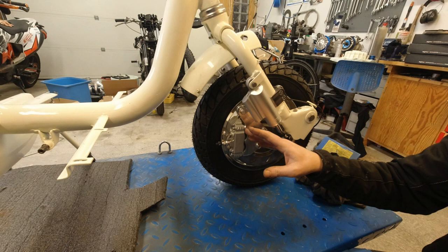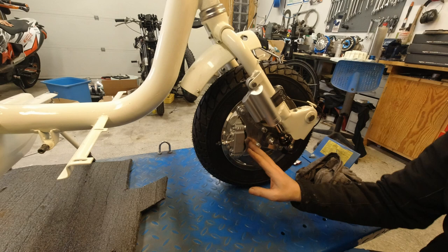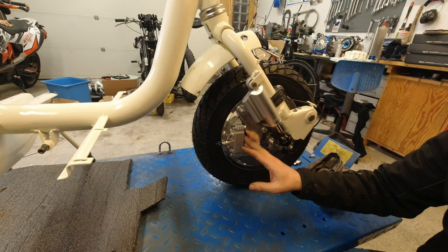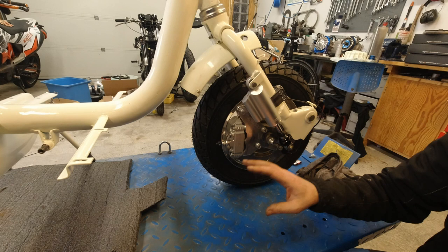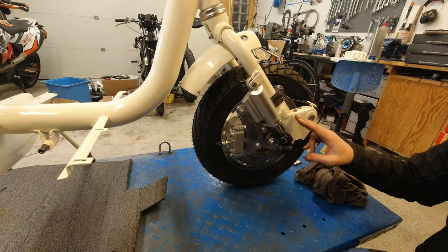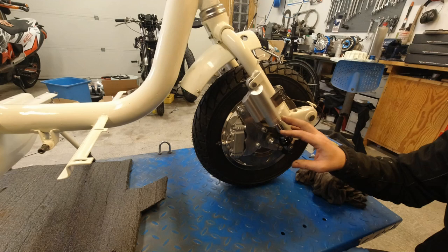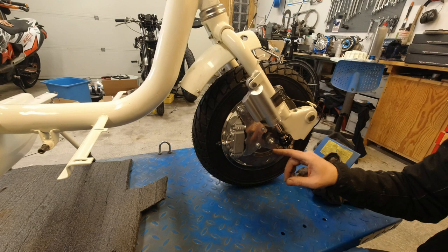I didn't show you how to build the fork because I've already done that, and if you're interested in how you fit the BGM front disc, I'll post a link up there. I built this while the back of the scooter was at the painters. I went for the BGM disc because it looks original on one side, it's got a nice big 220mm disc, it's not quite as expensive as the CASA Performance disc, and I could use my existing master cylinder so I saved a couple of pennies. The setup is these beautiful F16 BGM shocks with the BGM 10% strongest spring - the same setup I had on my series one and I loved it, compared to the PM Tuning disc I had on this which I thought was pretty dismal.